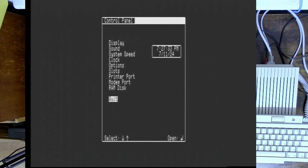And you can see display, change display, sound, what have you. One of the things is, what are the slots in the machine? An Apple II Series machine has typically 7 slots, and more or less, a lot of the slots are sort of defined. There's standards for what goes into each one. For instance, slot 6 usually was where the 5 1/4 inch floppy controller went. And most people put their printer interface in slot 1. And slot 3 was always the video part.